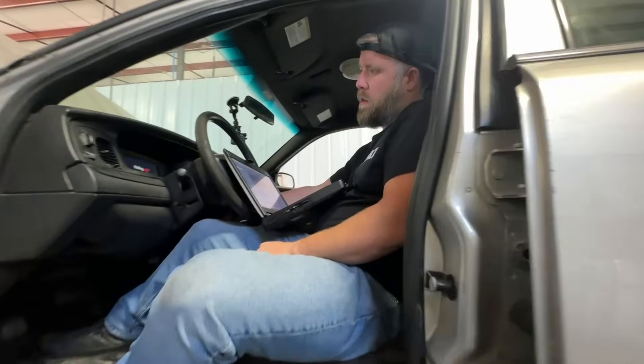With our timing verified, it's time to strap this thing down on the dyno and make a pull. We're going to be doing frequent plug checks to ensure we're safe — checking where the timing mark is on the ground strap of the plug. We might need to go to a colder heat range. We're running BR7EF plugs, a very popular plug for turbo applications that's been working great at this power level, but this thing's going to the moon. We've got good fuel, a good fuel system — the only direction from here is up. Let's strap this thing down and make a pull.